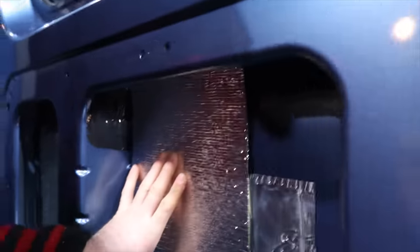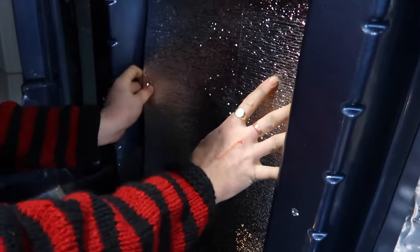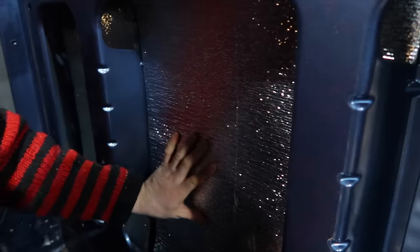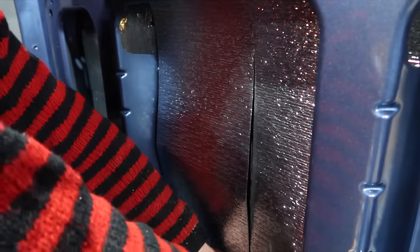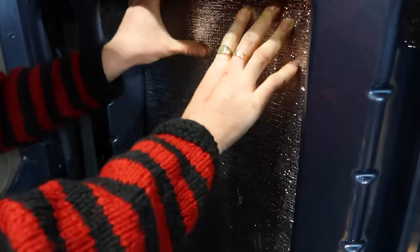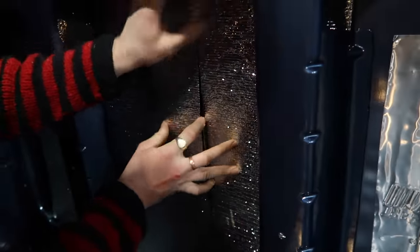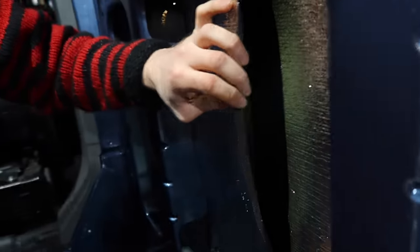2.5. That's nice as that, let's just eye the other end, make sure we're fitting flush. Fit over it like that. Oh, I've mitred it on purpose so you get a fit. Don't swear. Oh, sorry. You're making work for me. Okay. You've done a spade fit. It's perfect. You see how I've mitred that there, lads and lasses. Yeah, that's as flush as it can be, innit? Proper flush. Right, let's get them stuck on.